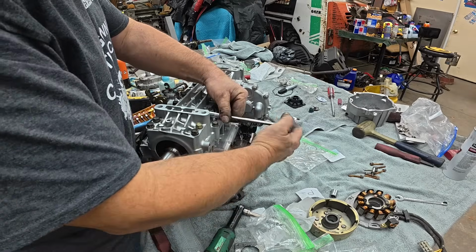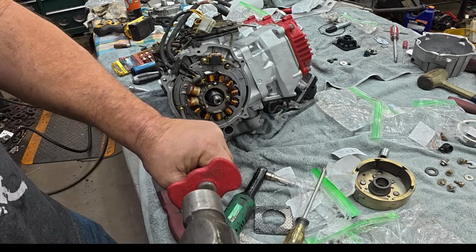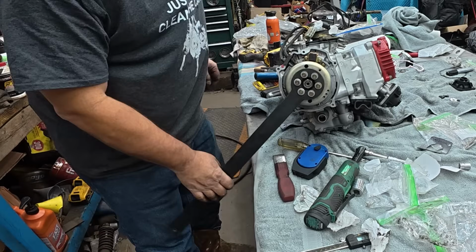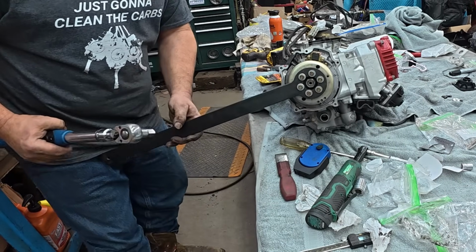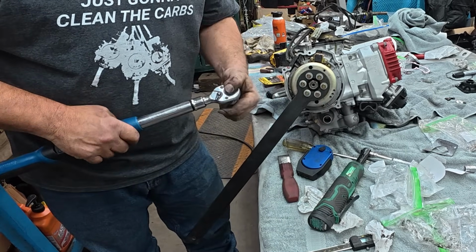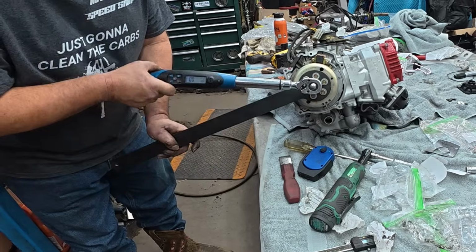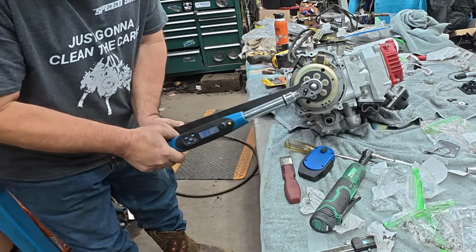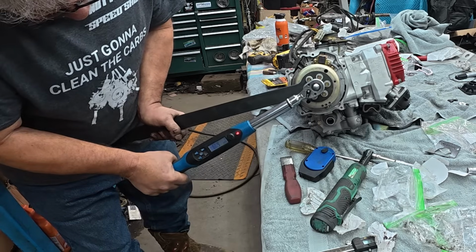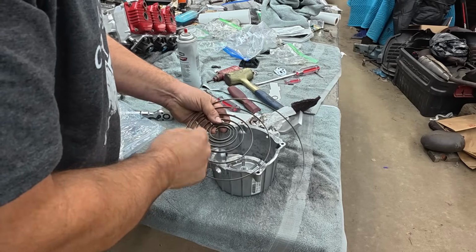Crank drain plugs. Don't forget your crank drain plugs. All right, locking in the stator. Make sure you put the right bit in your impact driver. It's a number 2 for the oil pump, but it's a 3 for the stator. All right, torquing up the flywheel. Service manual says 60 foot-pounds. Look at this awesome wrench. So Glenn Creedmoor made this. Glenn is a patron, and he sent one to Todd, and he sent one to me. And it's awesome. So I got the old torque wrench set to 60. Oh boy, that's better than the rope in a hole trick. There we go. 60 foot-pounds. Real nice.